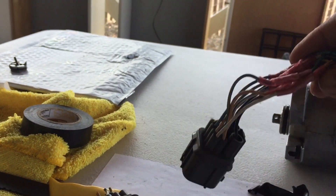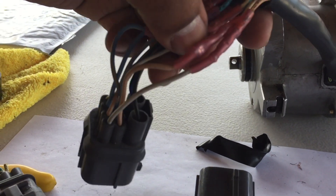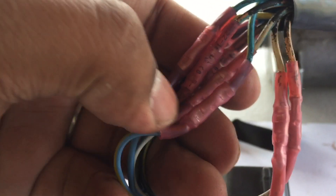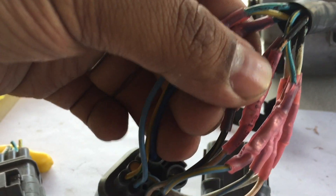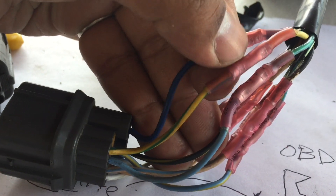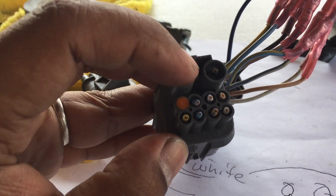And that's how you do a conversion. I made mine OBD2 — it was an OBD1, but I wanted to convert it to an OBD2. Vice versa, you could do it the same. And this is an OBD1 distributor and I made it into an OBD2. This is orange to white, this is white to orange. Everything else, the color matches. Color match. Color match. The black and yellow — that color matches. Then blue and blue, just light blue — that's color match. Then yellow with green stripes — that's color match. And then you have your RPM, which is the blue. Don't get mistaken with this — this is the RPM. The top right here is always the RPM. Do not get that mixed up guys — the RPM and the light blue.